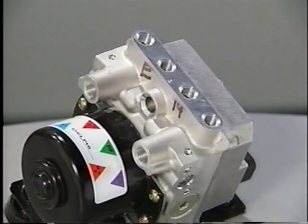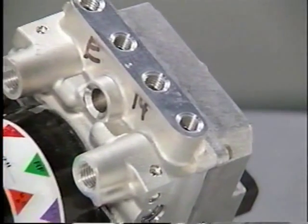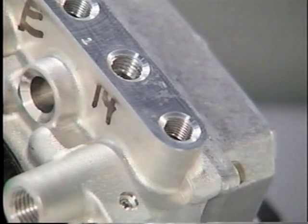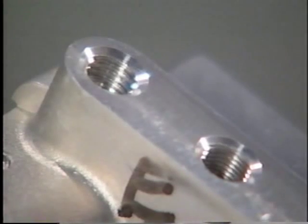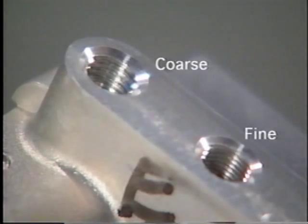The BPMV has two inlet ports and four outlet ports. The four outlet ports go to each corner of the vehicle. To further error-proof for the plant and for service, those four outlet ports have varying sizes — some are 10 millimeters, some are 11 millimeters in diameter — and they have different threads, coarse and fine, alternating across the top of the brake pressure modulator valve. The DBC-7 system for '99 is identical in initialization from '98, and noise is a little better than '98.